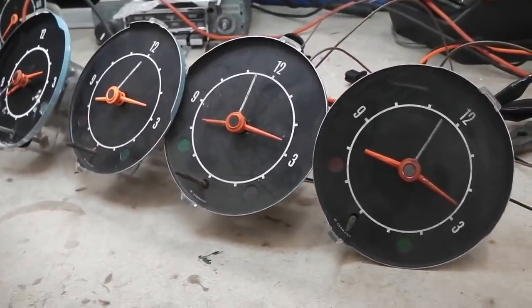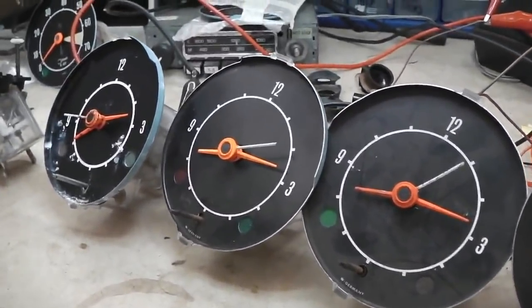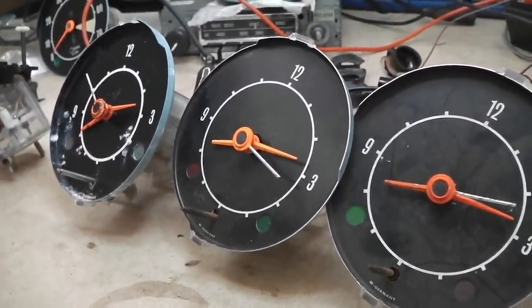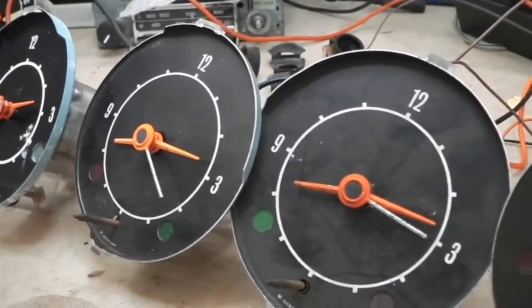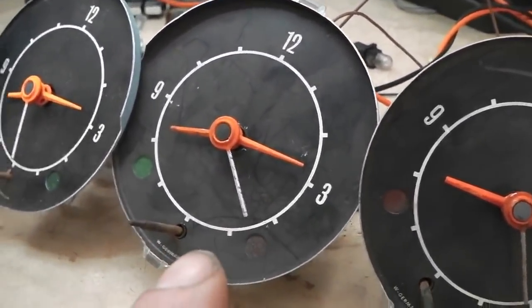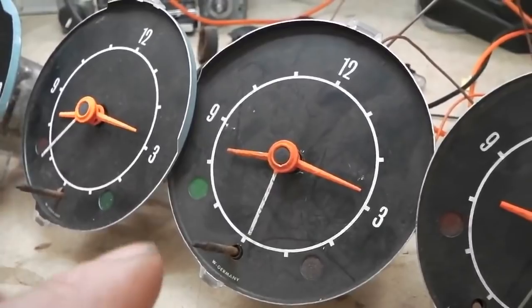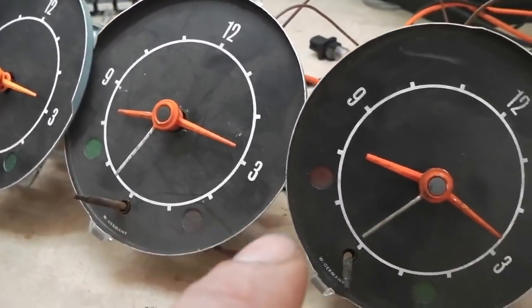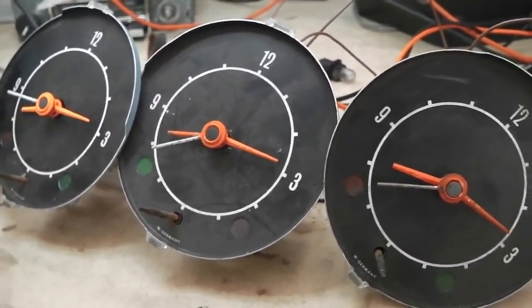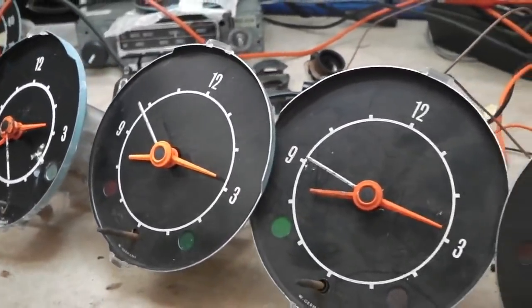Okay, here we go. How about then, if we get one clock to be our master clock, let's say it is Bramble's clock. Let's say Bramble's clock manages to keep perfect time. Or if it doesn't, we set it until it does, and then once we've got Bramble's clock at perfect time, we can then get these, and instead of having to wait hours and hours and hours, if the second hands all stay together, the chances are these clocks are in the same setting. If straight away we notice the second hands drift, we can then use a tuning screw at the back and start the process again, and maybe that'll give us a fighting chance to calibrate these. I don't know, it's an interesting one, because it does take a while otherwise to wait a day between adjustments.